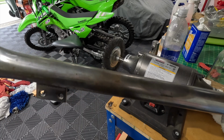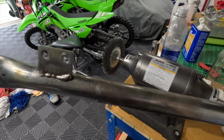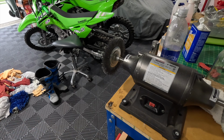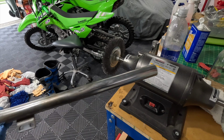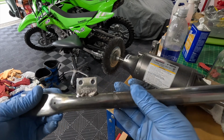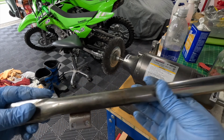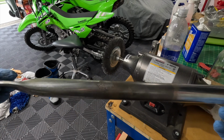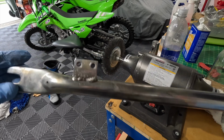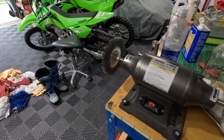All right, this one has some severe pitting. Again, this is not going to be perfect, but these fork tubes are not like somebody's going down the street in a go-kart. These fork tubes are not like dirt bike fork tubes where these actually have to slide in. The springs on top do all the work, so these could be damaged all that you want, and there's no seals to worry about or anything like that. We'll finish cleaning those up, and then we'll be done with yet one more thing.